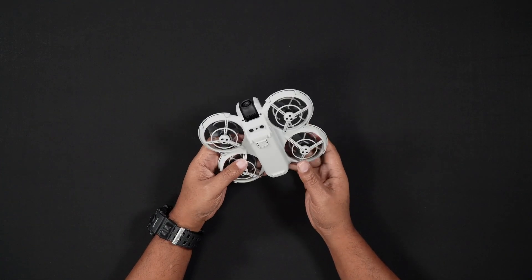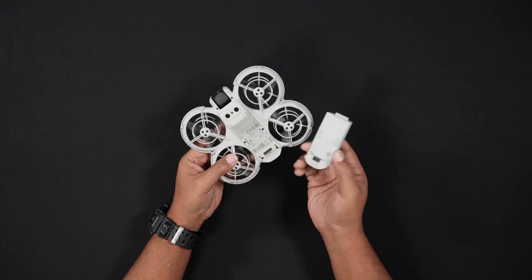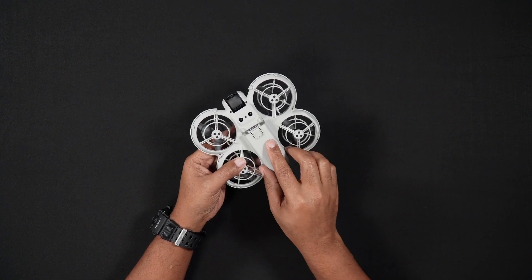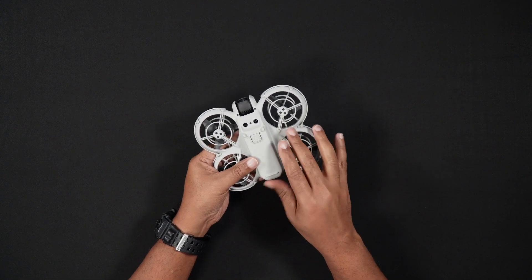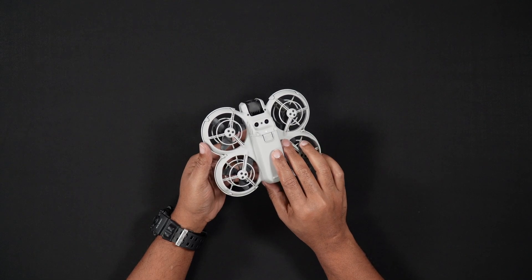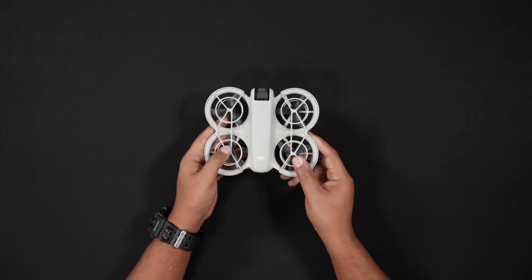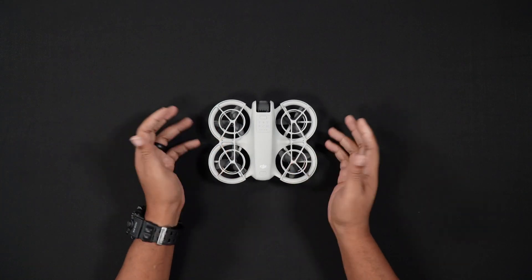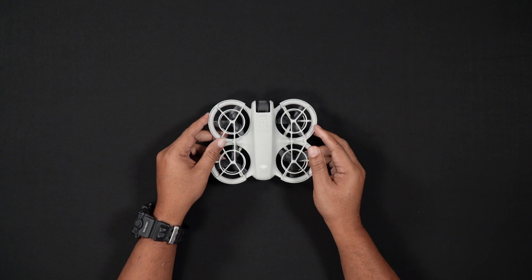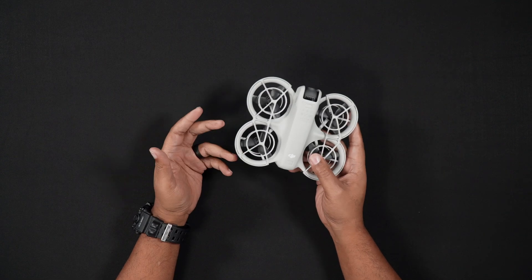To remove the battery, press the tab and slide out the battery. To put the battery back in, align the grooves on the battery with those on the NEO and slide the battery in. You hear a click when the battery seats correctly. There are two different ways to charge the NEO's batteries. Sadly, as with most of DJI's newest drones, a wall charger is not included. While DJI suggests using their 65 watt charger, we found that any 65 watt or even 100 watt PD chargers will work well.